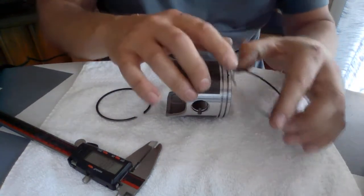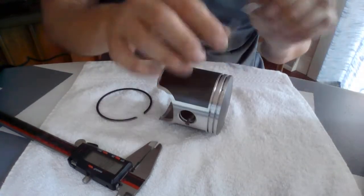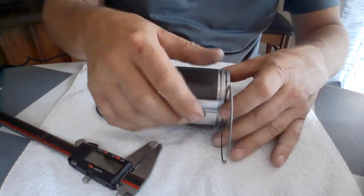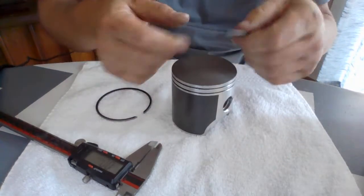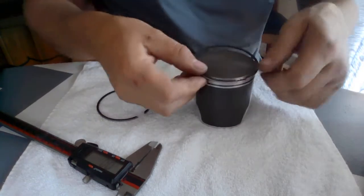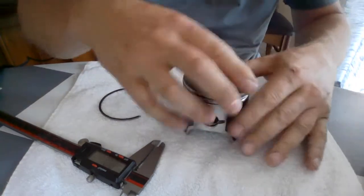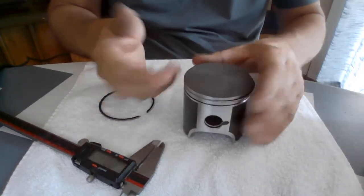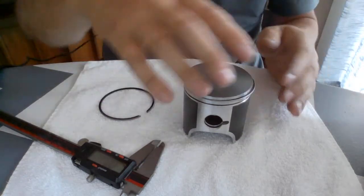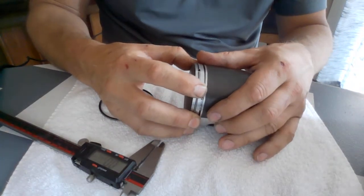What I found out was that this ring has a top side and it's conical in shape. Even though it does not fit in the groove the way you'd normally just grab a ring and check the ring gap, if you actually install it you'll see that it nests down inside — the groove in the piston is also conical in shape. It actually comes in at that angle, and so the ring fits perfectly in there.